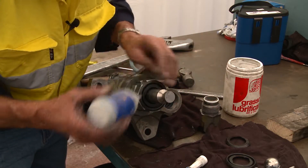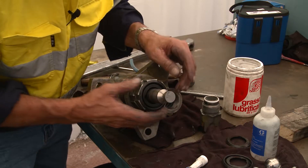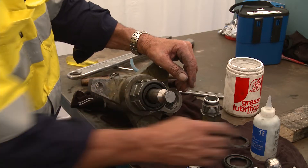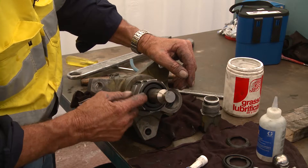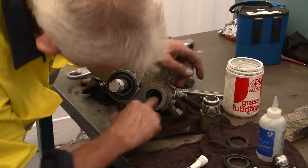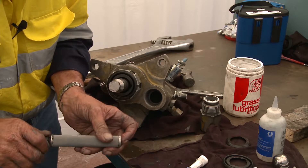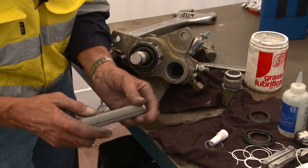There's no point filling the wet cup and trying to put it on the machine because it'll all run out. The one thing you must remember is to lubricate and complete the whole process by filling that well with oil prior to operation. Spinning it around, we've got our filter cavity. The filter we've cleaned — remember the stem must be clean. All the flutes are clean in the stem and the filter's clean.